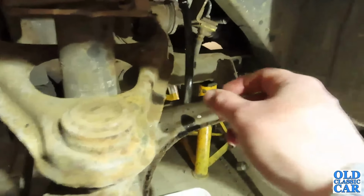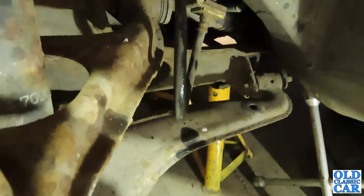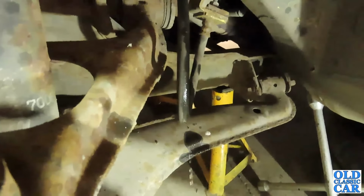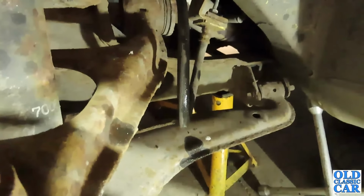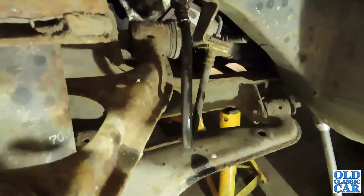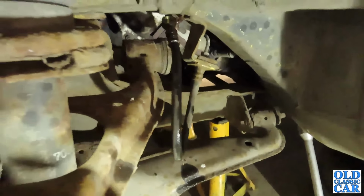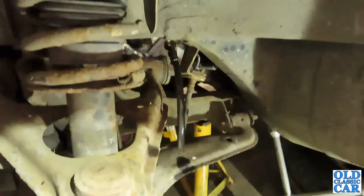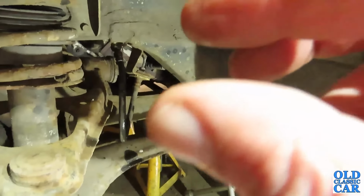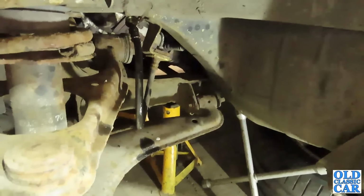But also, I always think if you clamp these, you could potentially damage the internals of the flexi hose itself. So I'm never very happy with the idea of putting a proper clamp or mole grips, or you see all sorts of things being done, but to be honest, I'd rather just bleed through fresh fluid anyway, and then you're done, and there's no risk of this collapsing, because what can happen is sometimes the internals inside the flexi can actually close up, and that can lead to brakes not releasing properly.